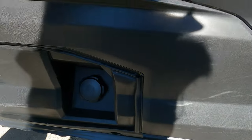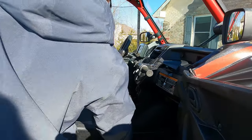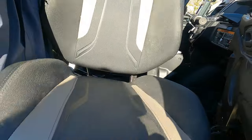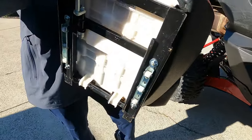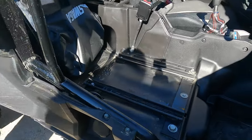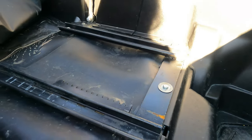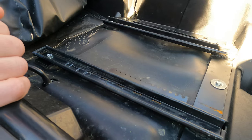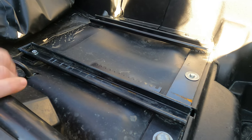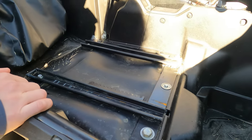We made it so we could actually remove our seats. What we did was weld a track here and use the existing holes. People do make kits for this, but we were being cheap and didn't want to spend the extra money, so we just made our own — it's just a few pieces of metal front and back and some bolts.